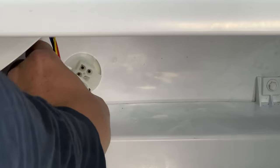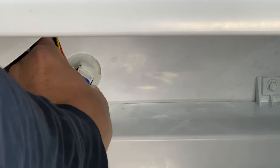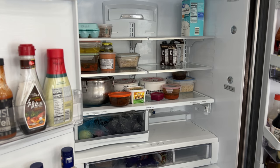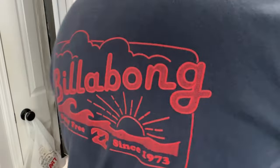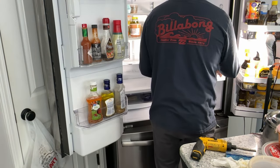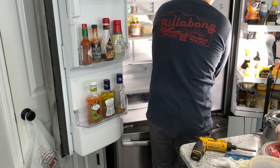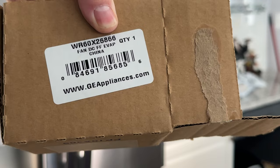At this point you can plug it back in. Don't go sticking your hands on the metal bits back there — we still have the refrigerator plugged in. Put your tray back in, go order the part, and when your part comes in you can start disassembling your refrigerator. The point is to verify the fan is broken before you tear everything apart, so we minimize downtime.